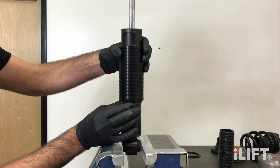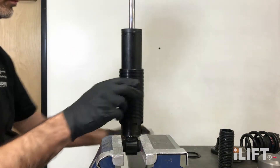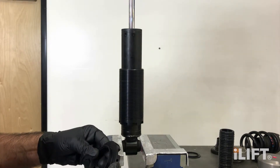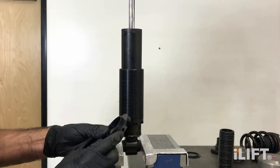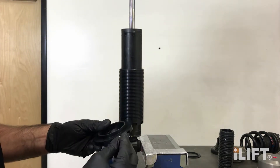You may need to compress the circlip with a tool to fit the sleeve over the clip. Install the supplied set studs into the supplied threaded perch with the nylon tip on the inside, but leave them loose.